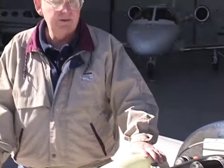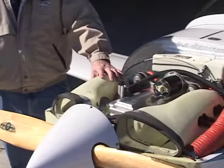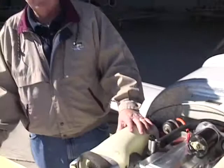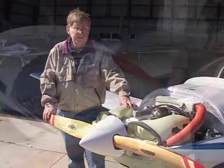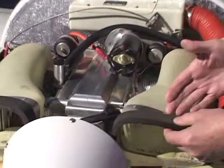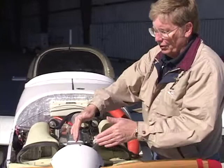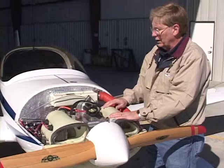The Jabiru 2200 is an 80-horsepower four-cylinder flat air-cooled engine. Maximum RPM on the engine is 3,300; I peak it out at 3,250 with the prop I have on it currently, which seems just about right for this installation, with excellent climb and cruise performance. These are the air intakes that do the cooling for the engine — I've modified them quite a bit to get the right type of cooling, which has been a major portion of the effort. Down below I've also got an oil cooler and some ducts up front for oil cooling.